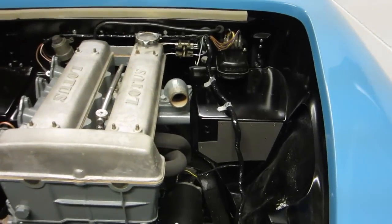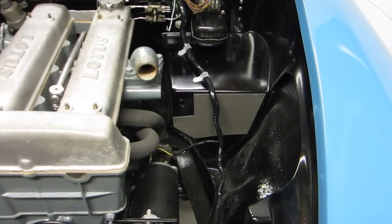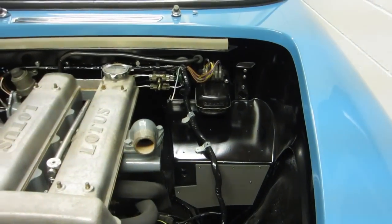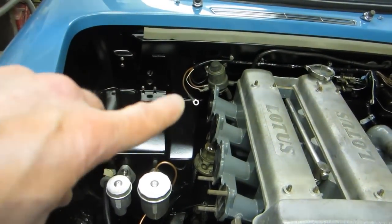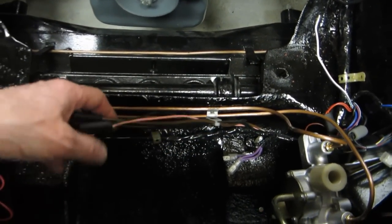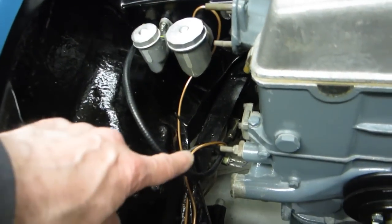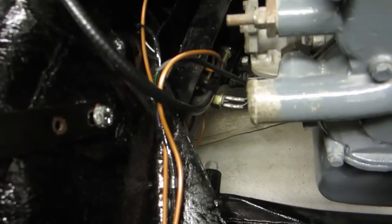A bit of catch up: you can see I've got that mill board in there — it's like compressed cardboard, pop riveted in place, copied from the one that came off which was in a real mess. I've replaced the two little plastic clips with new ones gifted by a friend Richard. I'm pretty sure I know where that spare blue wire leads — I think it goes down to the fan wires. I've got the brake pipes into the servo now, which run across to the master cylinder and down to a five-way connector which has got the switch for the brake lights on it.